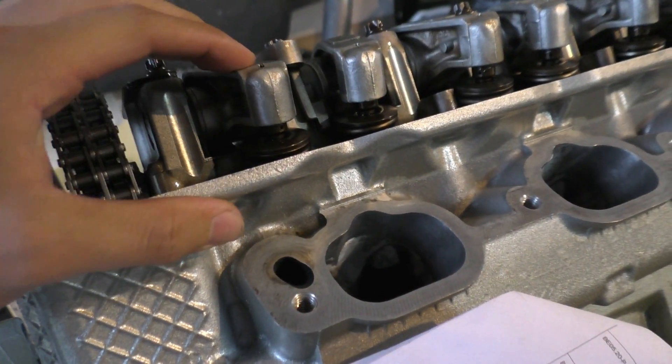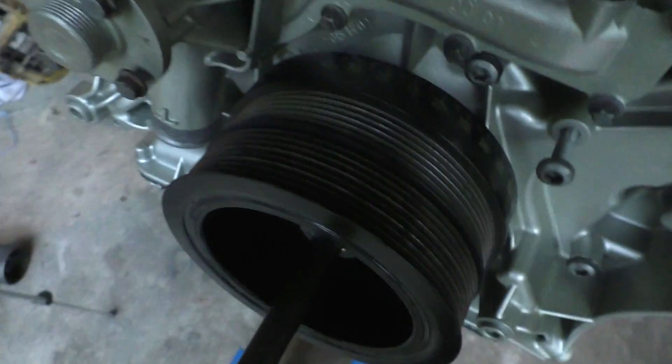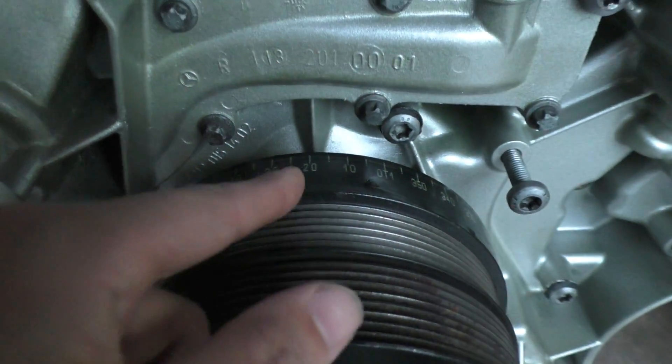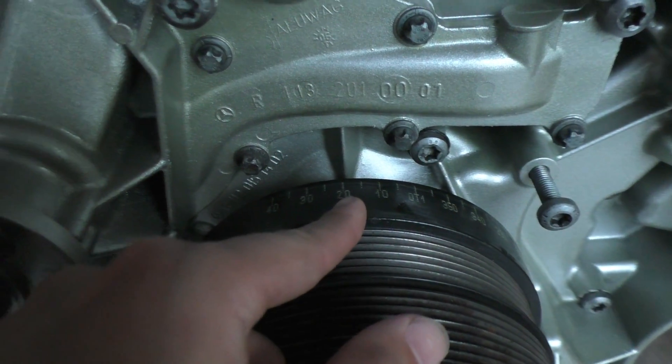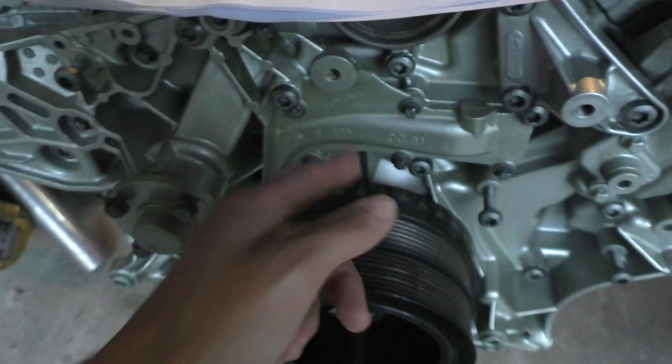There's no play left in these rockers now — so that's the degree mark where my intake valves are starting to open. That's at exactly 20 degrees right now, so the timing of the inlet valves opening is 20 degrees for my engine. I'll note that down.